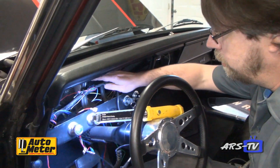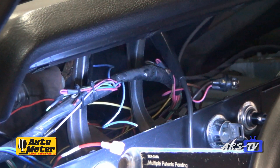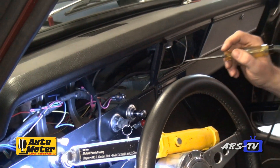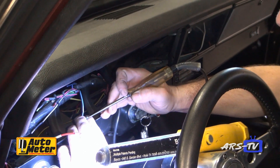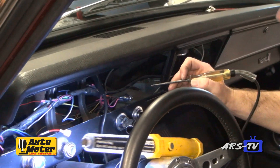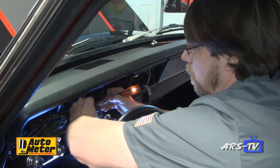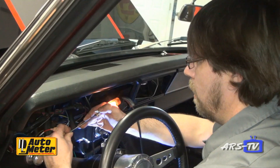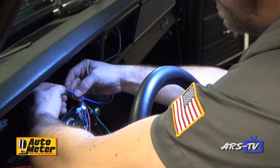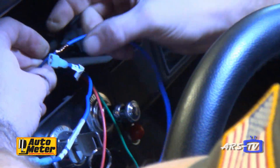Now I've got most of the wiring cleaned up. I've taken some heat shrink, put it over the ends of the wires after folding the wire over, kept it all intact, and zip-tied it to the original harness. Now I'm getting ready to verify the wires that are left over for turn signals. I turn the key on, put the left turn on, and just using a simple test light, I can verify I've got the right wire. We've got two dark blue wires that we know are for the right turn, and left turn is on the light blue wire. When you go to extend a wire and don't have an appropriate connector, you can just make a cross out of them like so and simply twist them together to make a straight line splice.